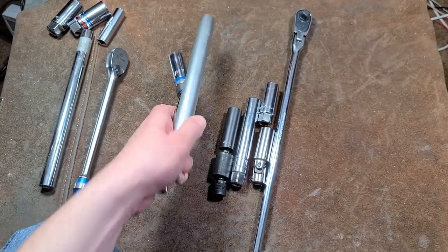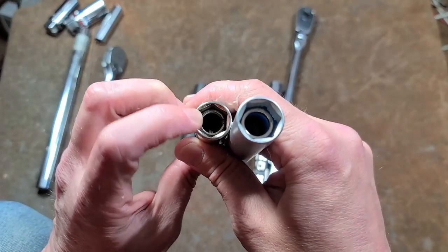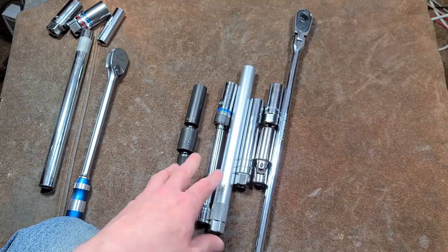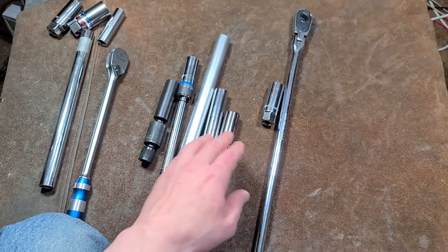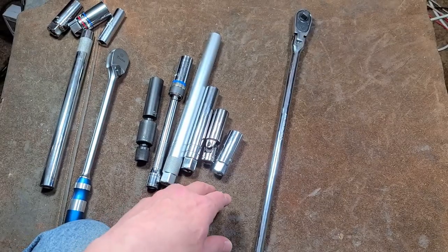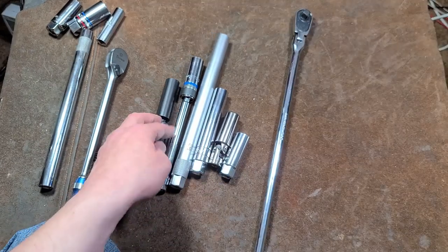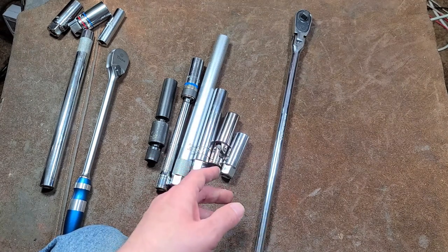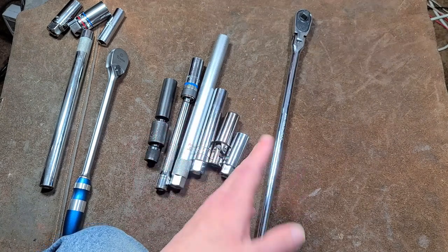This PT happens to use a rubberized boot, and I even think the Graze Pneumatic does too. But nicer ones will use rare earth magnets inside, which provide good holding power but not so much that the socket gets stuck on the plug. So that's my little video on the six spark plug sockets that will allow you to get into just about any spark plug with a whole lot less hassle than figuring out different universal joint and extension combinations — you can just grab these and one of them will inevitably work. I really appreciate everybody who's been subscribing and supporting the Catus Maximus channel. If you haven't subscribed, please consider doing so. Until next time, Catus Maximus out.